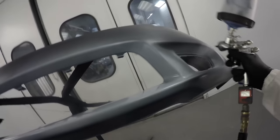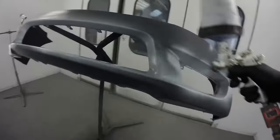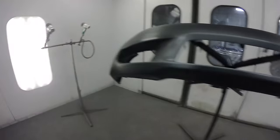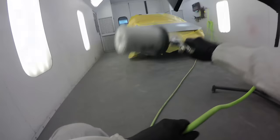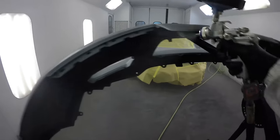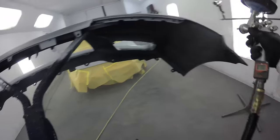What I'm applying here is a sealer. A sealer is basically a primer that you don't sand. A primer surfacer is something you'd put on, then sand, then apply your color over. In this case we don't have any major filling to do, so we're using a sealer. Here I'm using it mainly to change the color from black to a lighter gray, because my silver is going to cover over this a lot better. Sealer covers extremely quick, gets into those offset areas, and costs less.